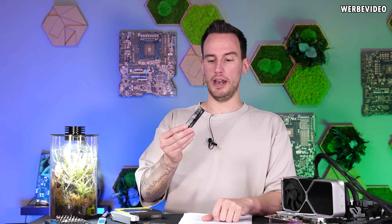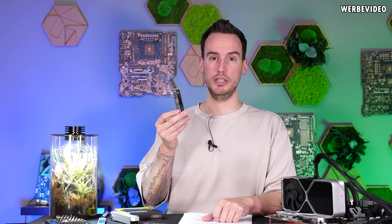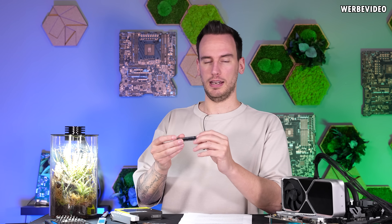With the new controller this is much easier to handle. The biggest problem however is still the price. For comparison, the Lexar NM790 is a Gen 4 drive, also 2 TB, and costs less than half — around 120 to 130 euros here in Germany. It's not that much slower, also DRAM-less, probably fine for gaming, and costs less than half the price of a Gen 5 drive that's only about 25% faster. It's probably the much better option. Still, I appreciate the development in this segment and the improved efficiency — now we just need the price of Gen 5 SSDs to come down. Thanks for tuning in, see you next time, bye bye.